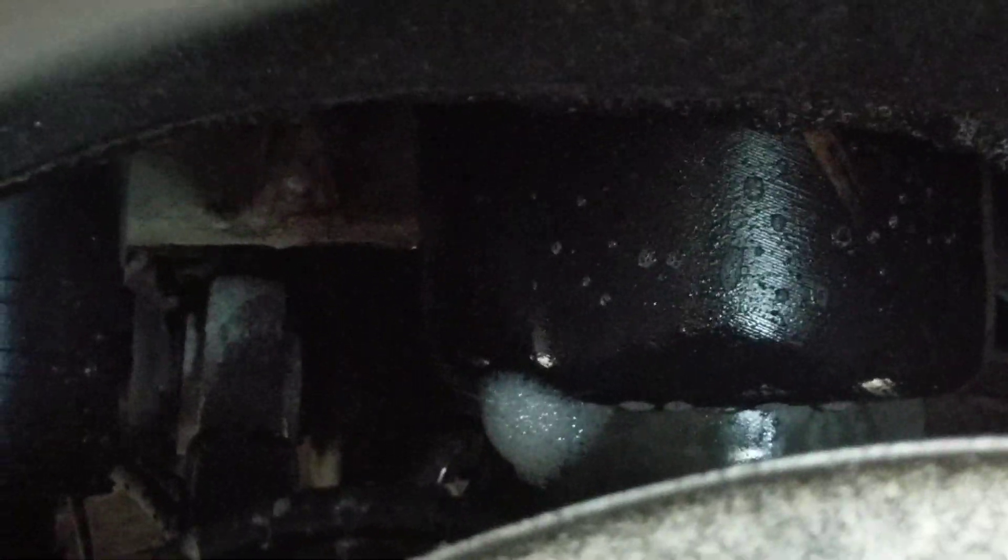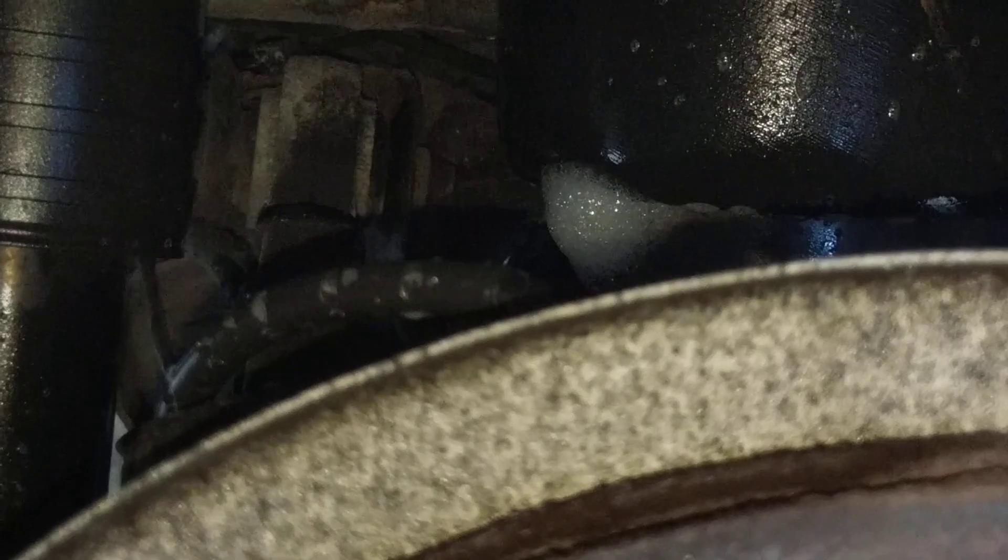You can see it's leaking air on this side. That's how you check — put fairy liquid in a spray bottle, get in and spray it on the airbag, then wait. You can see the bubbles collecting — they're still going. Even with no light — put the light on — there you go. You can see it's created a huge mound underneath the airbag with air just coming out into the liquid. That's the leak.